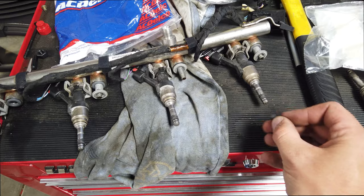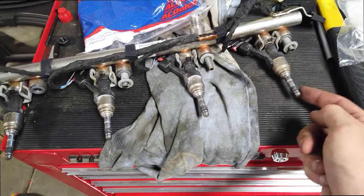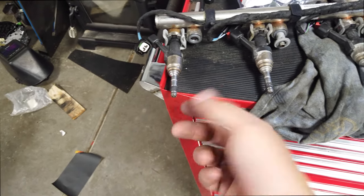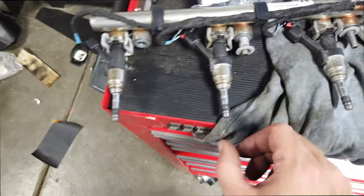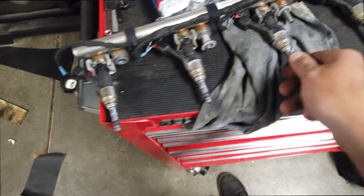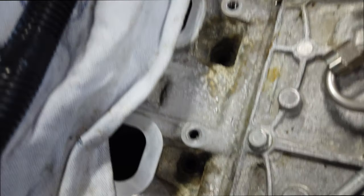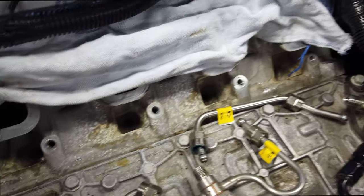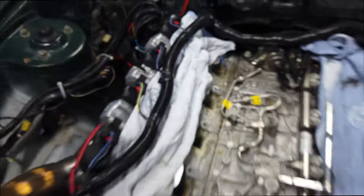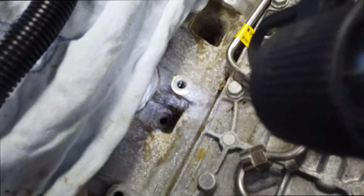I ended up using a pan tip to help stretch the seals over, but it may have stretched them a little too much — they feel slightly looser than the factory ones. They don't look quite the same, but it is what it is. I'm going to clean up the injector ports real good without dropping anything into the engine and see what we can do. They're pretty gross.